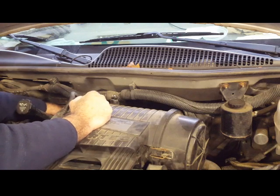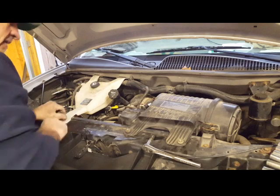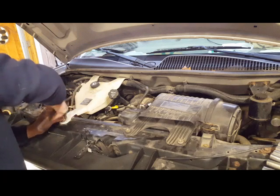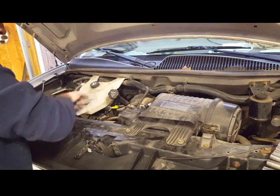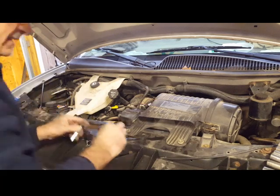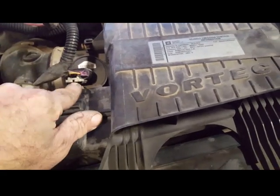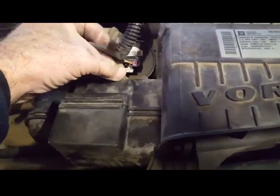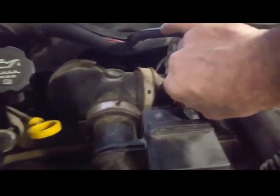I'm going to put the vacuum line back in the side — just stick that in there and tighten this up. Everything was 10 millimeter so you shouldn't have a problem. I noticed I need some fluid in there. That's nice and tight. Now this is the other plug you have to reinstall — that's the safety clip that holds the plug from coming out. Push this in, hear a little click, then push in the safety so it doesn't come back out. The bolts are in place and the throttle body's back on.